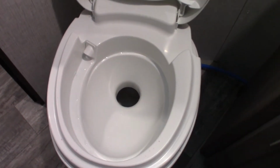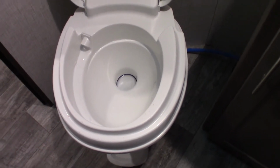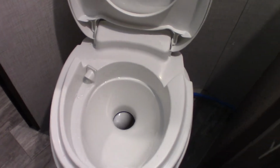and your chemical. So if you're going to stay at the campground for another week and you have to dump this black tank, for example, as soon as you dump it, you'll come back in here and repeat that procedure. A gallon or so of water and some chemical. You can't use it dry. Obviously the smell will be substantial and it can also get clogged up.